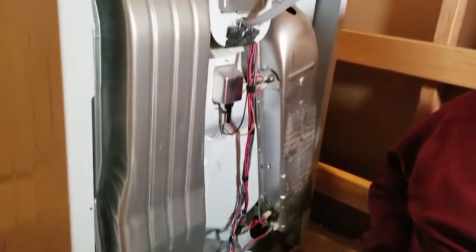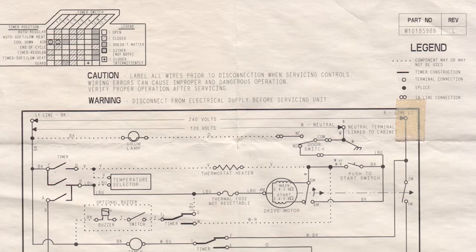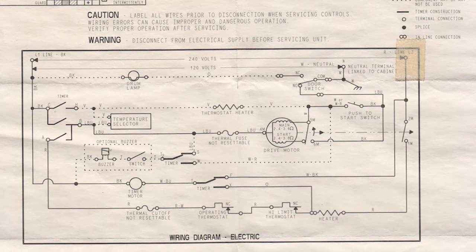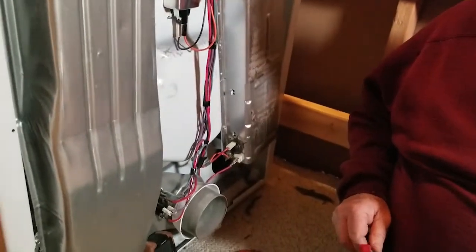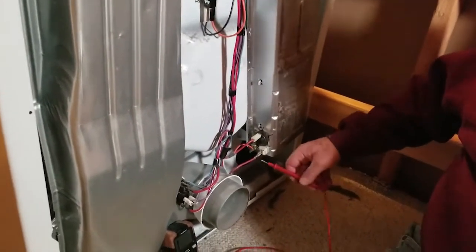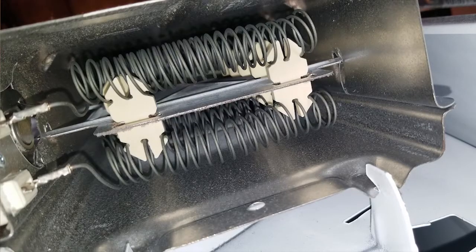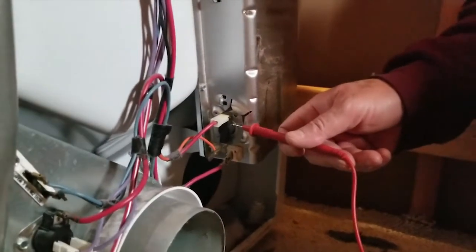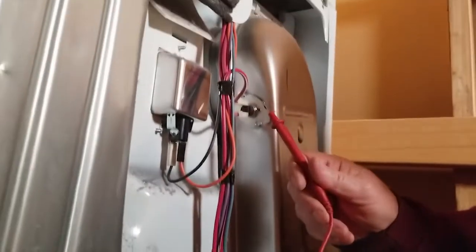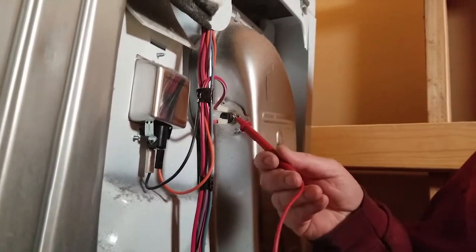Now that we have the back off, let's take a look at what we've got here. We did look at a wiring diagram of the dryer, and we'll see there are several elements here that are protecting from bad things happening. Down here we have the heating element — this is where the connectors of the heating element are. Right above that is the high limit thermostat switch. Up here is a thermal cutoff thermostat, and that one's non-resettable, so if that goes it has to be replaced.